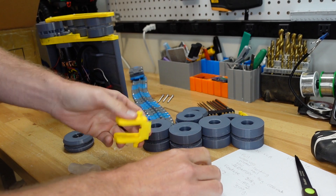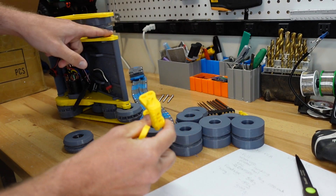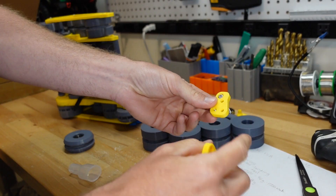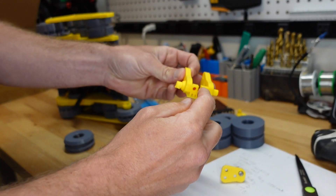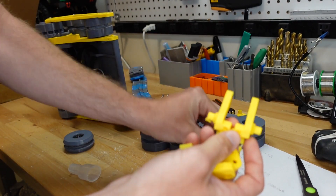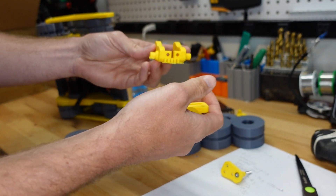One other thing I wanted to install today is some new tensioners. The stock front tensioners just tighten by friction, whereas these new ones are a little bit longer and have screw tensioners that get installed from the front. That helps hold the track tight and I think they're going to be much better than the stock ones. I'll go ahead and get them installed and show you what they look like.